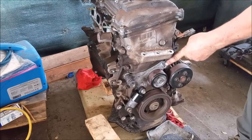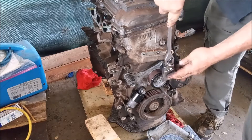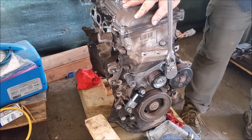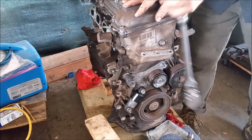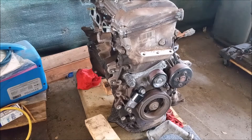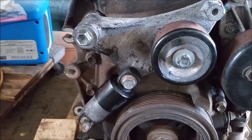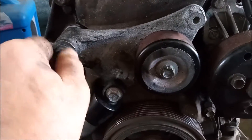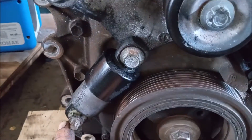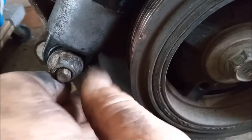The tensioner has a nub right here with a 19 millimeter socket head. You just slip the socket on it in the car and you pull towards you. This compresses the damper strut of the tensioner and it allows you to remove the belt. The tensioner is bolted into the block with one long bolt right here, and the damper arm sits on a stud with just one nut.